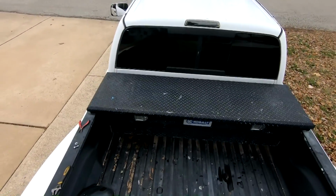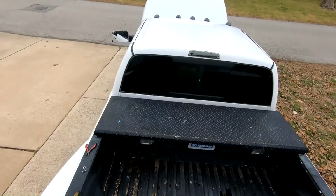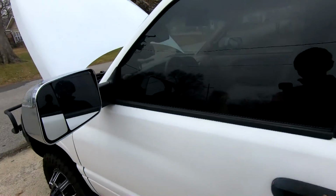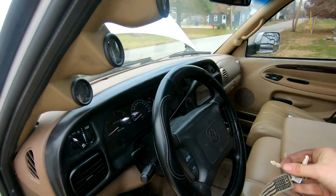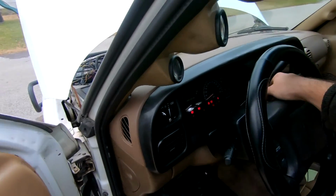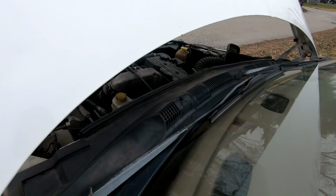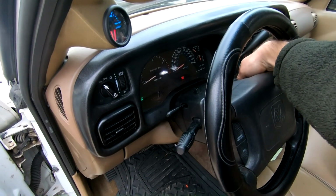So, easy day. I think that's really about all we have going on with the truck right now. So let's go ahead and turn it on and make sure everything looks Gucci, and then we're good to go. All right, let's crank this thing on, make sure everything's good, and then I think we've pretty much got everything buttoned up. I'm gonna do a wait to start real quick. Cold areas like this, I would suggest highly not deleting the grid heater. Super important for getting a nice, easy cold start.